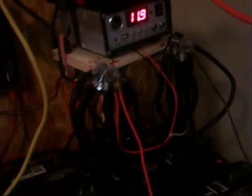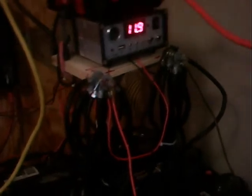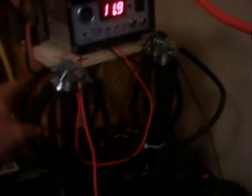Wire holding all that 40 amps as it runs through the daisy chain batteries. I don't. I have only 5 amps coming from each battery, well, in theory. And these wires are way more sufficient to do the 5 amps as opposed to the entire amount. So far it's worked pretty good, and I don't know if everybody can do that, and it kind of looks a little crappy with all these wires hanging out.